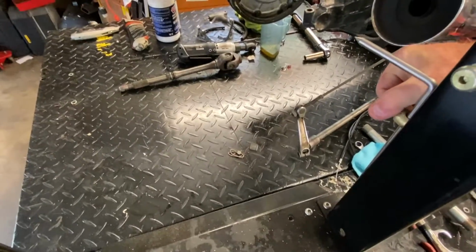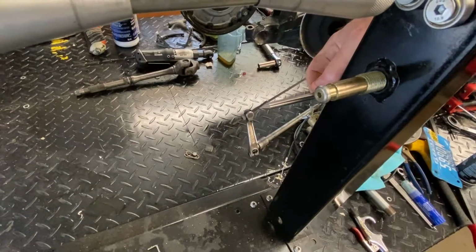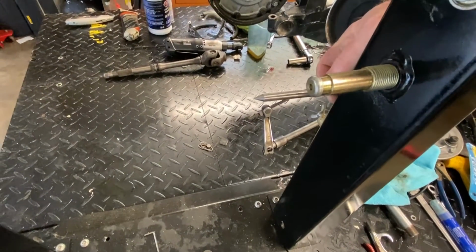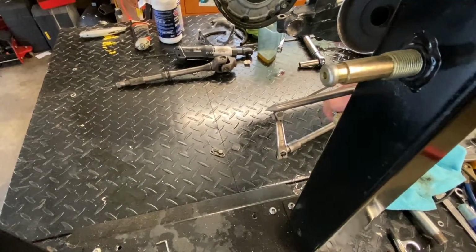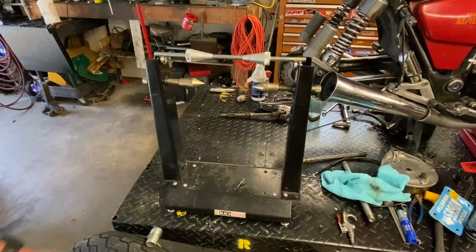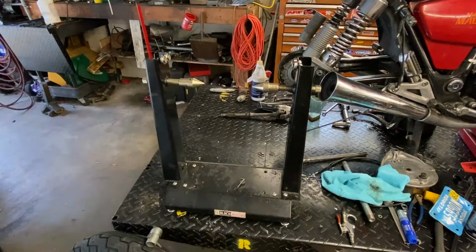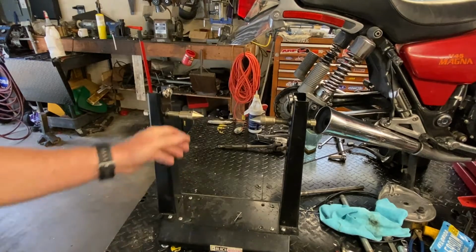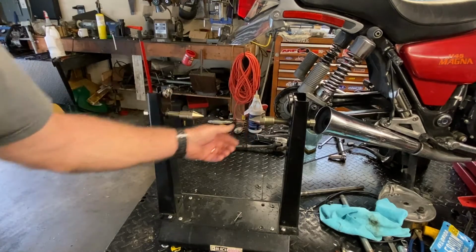I almost forgot to mention this is the fixed reference. It has an adjuster on it so you can change the height and so forth to go up against a rim. You need some sort of fixed reference, so when you spin a rim, you can actually see it moving relative to it. That's what this is here. I'm going to turn that out of the way so I don't get jabbed again. Classically it's used for spoked wheels, where we put a wheel right in here and then adjust the tension on the spokes. And that's how we use that.